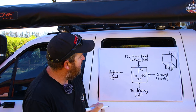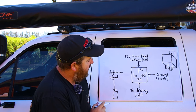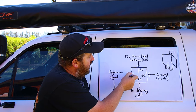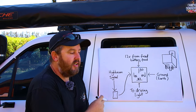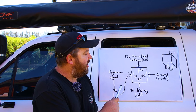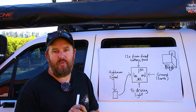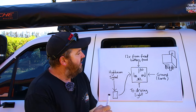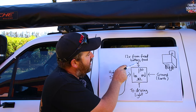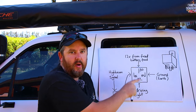What we've got to do instead is run it inside your car to a switch. It'll go into that switch from your high beam signal and then come out of that switch back into the relay. So now we've put a little breaker in the middle where we can actually cut that power — even if the high beam is on, it still won't trigger the relay and your spotlights won't turn on. A relay is basically like a switch. If it detects an earth and a power comes through, it completes a circuit and opens it up, allowing power to come through from the main battery through to your driving lights. If one of those cuts out, it'll close off and stop power going through.